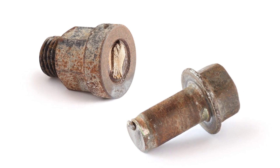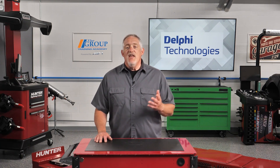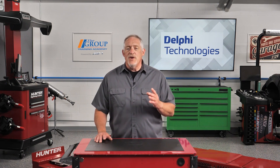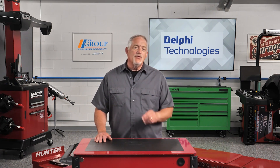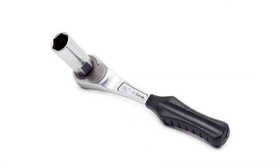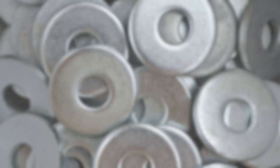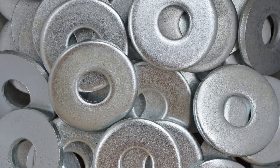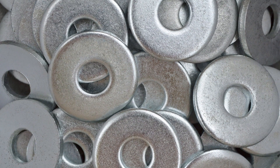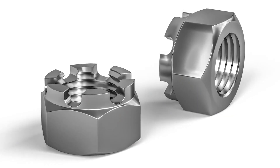The increased torque can also cause the inner opening of the taper to crack due to excessive clamping force. Many ball joints can have an initial torque spec as low as 15 to 30 foot-pounds and torque angles between 140 and 225 degrees. Never try to guess or use your calibrated elbow — instead look up the spec and use a torque wrench. Also make sure the washers on the studs are in good condition and installed in the right direction.